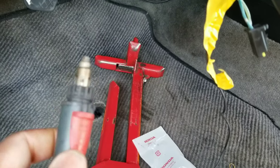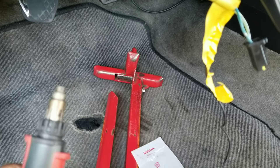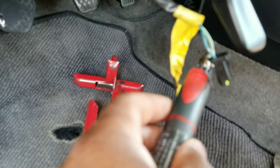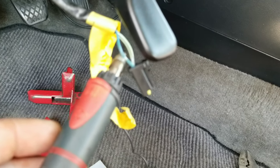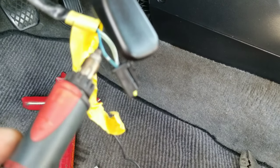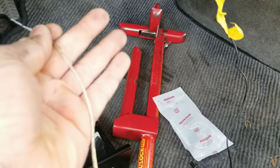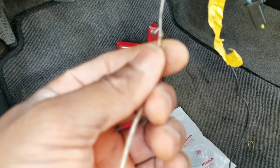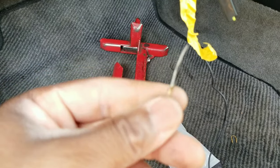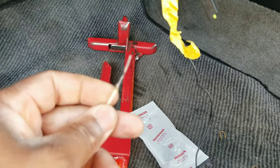The way I'm gonna tap into this blue wire, I'll put a torch — just a little handheld torch. I'm gonna put a little heat on that blue wire, and once that rubber gets hot it gets soft, just peel it back — it'll expose the wire. I'm gonna use this wire and tap into it. It looks like speaker wire I found in the garage. It's the horn button, it's not high voltage or nothing like that, so you don't need a real thick gauge — speaker wire worked.